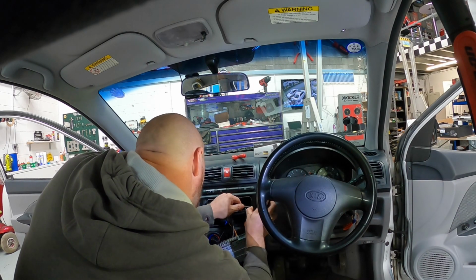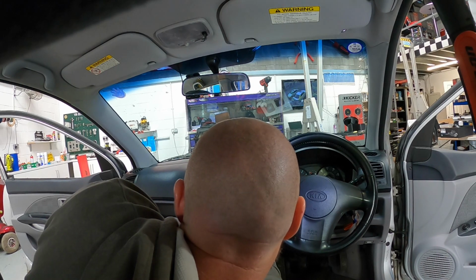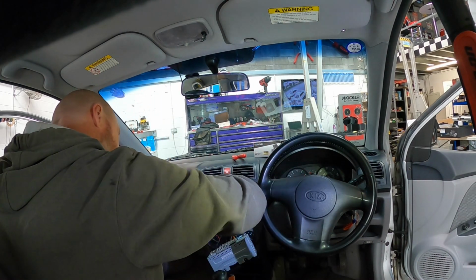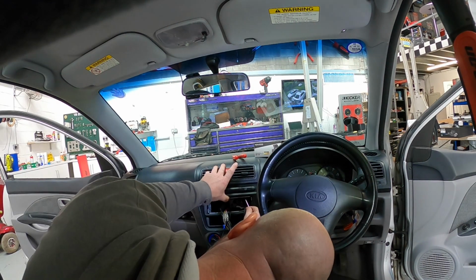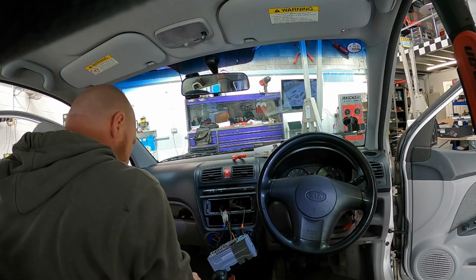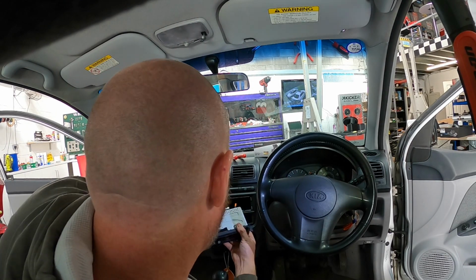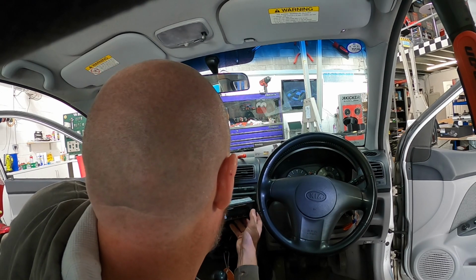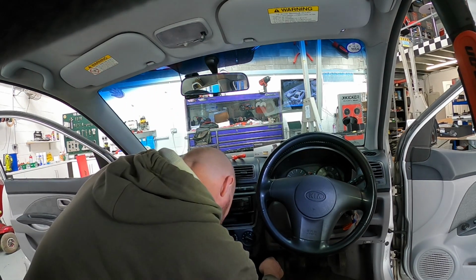Fold out your side tabs. This secures the cage in its little bezel. You don't have to do all of them. Many of them won't actually reach, but the side ones on the top far left and right do. Make sure your cables are tucked out the way. This is only a short chassis radio, so we're going to have lots of room anyway. So that goes in.